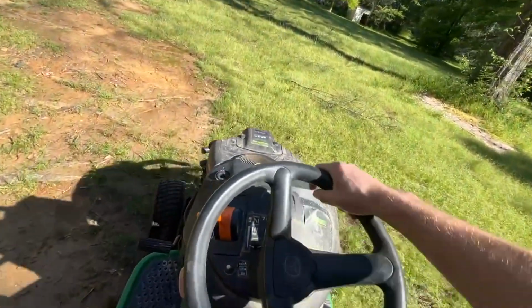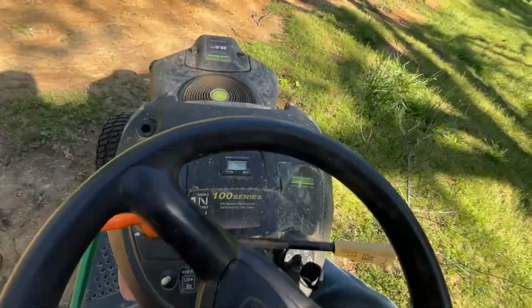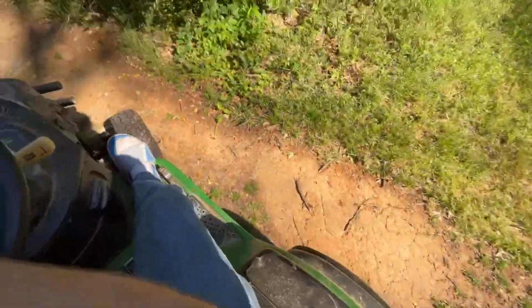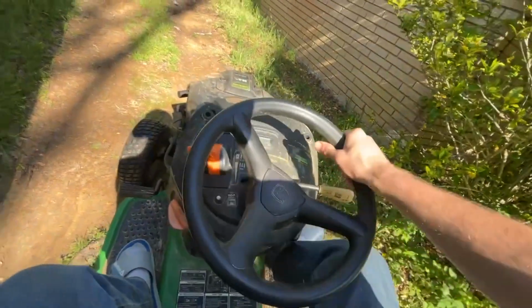At least it's easy to steer now. But that's about where the advantages are fixing to end. See, look at that. There's a problem with one of the wheels coming off the ground, because it's an open diff. But just by pure luck, you managed to get up this hill like this.